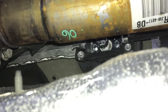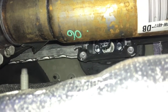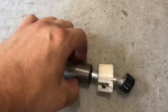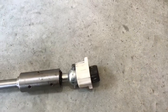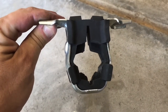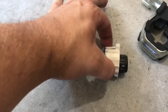Take out the two bolts on each side — four total — and drop the bottom of the shifter assembly off. With the bottom plate off, the whole bottom assembly comes off, and the shifter cup comes down with the shifter linkage. Take out those two 10-millimeter bolts and the whole shifter rod comes out from the bottom. This is the factory shifter. Notice this huge gaping hole the shifter sits in — this is one of the main reasons you're missing third or it feels notchy and sloppy, along with this soft plastic right here.